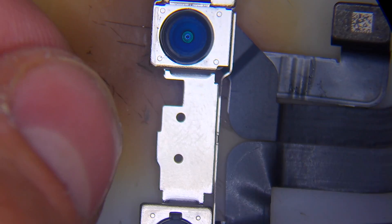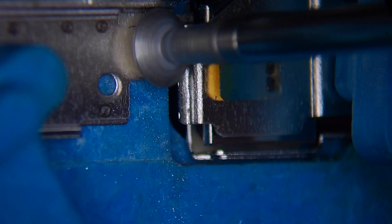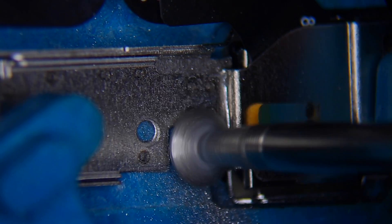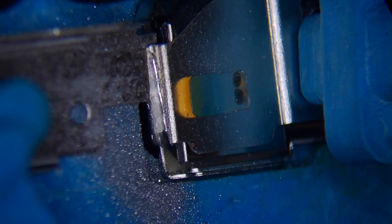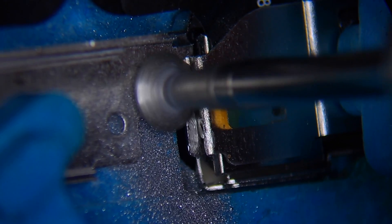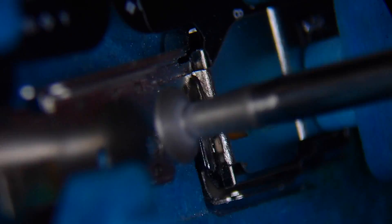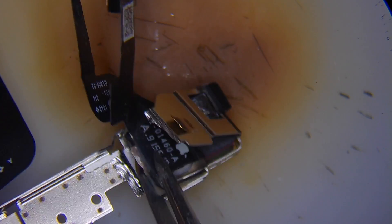Now to the part where we change the front camera — I'll try to explain everything in as much detail as I can. First, cover the dot projector and the infrared camera. Now we're going to open the part of the bracket that holds the front camera dot projector and drill it with my USB drilling machine. All the tools I'm using are linked in the description below. There is just a little piece holding the bracket, so be careful — the dot projector flex is immediately underneath.